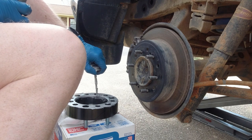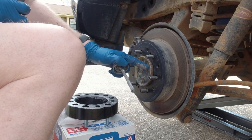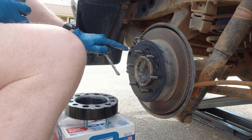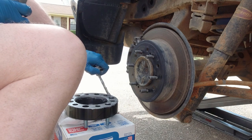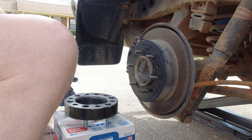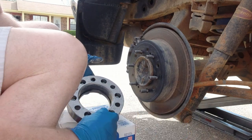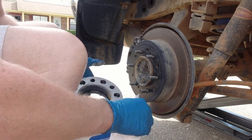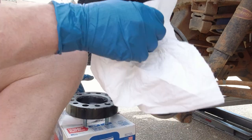As you may notice, I'm putting some anti-seize on the edge lip because of the hub sticking out — this is an area it can get stuck to. Any place it's actually going to touch, with the exception of the actual lugs, we're going to want to coat really well. Once that's done, I'm taking a towel and wiping out the middle of the holes so that we don't get anti-seize on our lugs when we go to install.